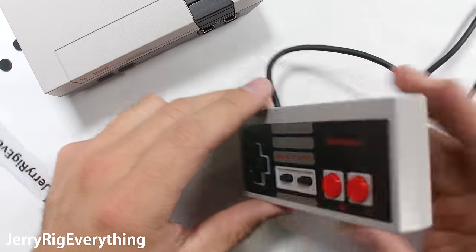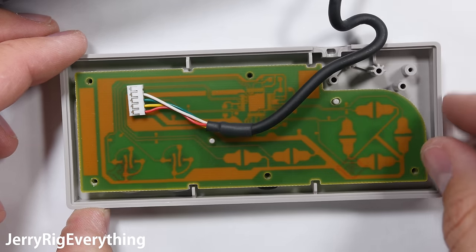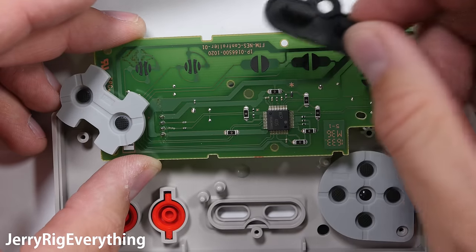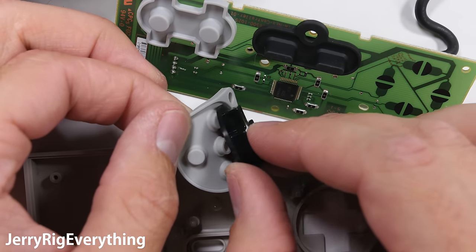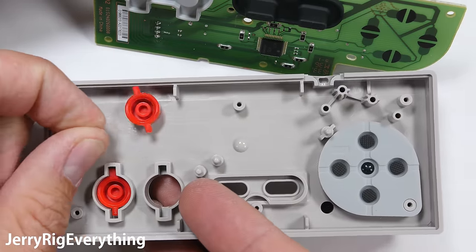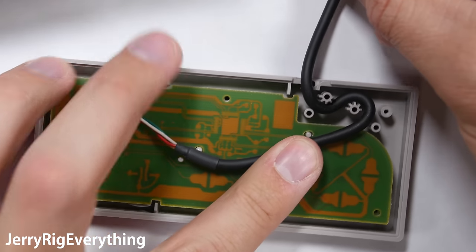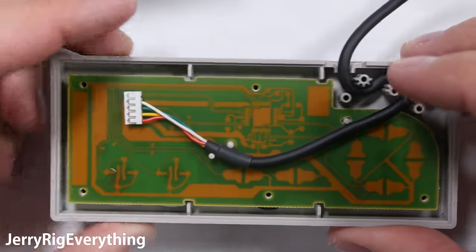Now onto the controller — this was pretty interesting. There are 6 Phillips head screws on the back holding it together, and after those are removed, the back housing comes free, showing us the wraparound folded cable and the first plug. Flipping the controller over, you can see the integrated circuit as well as the little contact pads that sense when each button is being pressed. Believe it or not, this controller is more complicated than the original. The 4 sided thumb pad is hard plastic on top and rubber underneath, with the same type of contact pads that the rest of the buttons have. The plastic tops of the A and B buttons slip out of their slots as well. The reason the cable is wound between all these little pegs is so that when the controller is pulled, dropped, or thrown against the wall, all of the stress tugs at the cord of the cable and not any of the actual plugs or the more important internal components. It's a pretty smart design, since controllers are probably the most abused pieces of any console.